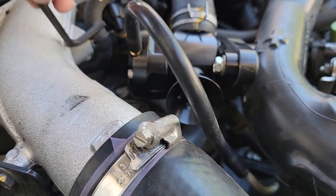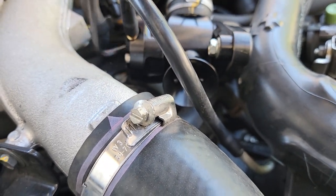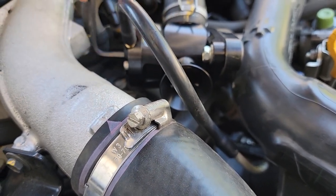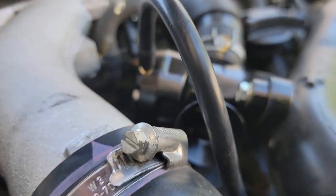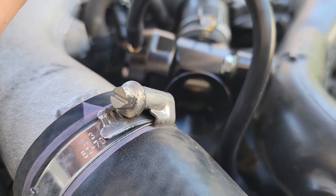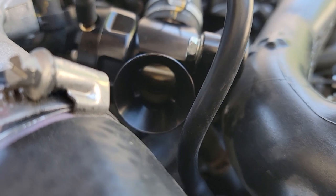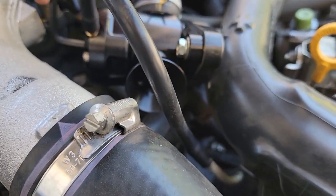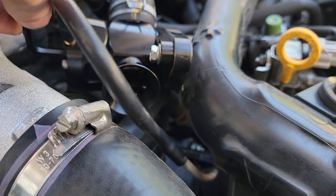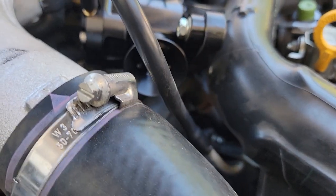So we're gonna want the inside part that's opening up to be closed before it comes back down to idle. That's why we're getting this stumbling, basically a vacuum leak. Right. It's almost there. It's not quite closing by the time it comes down to idle though, so we go down a little more. Are you flush with the bolt now? Is the bolt flush? Oh, the bolt's pretty in there. I don't know how far it went.